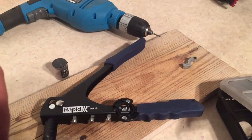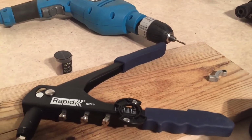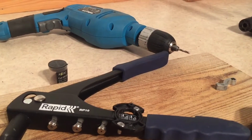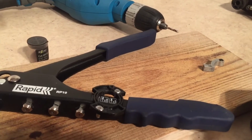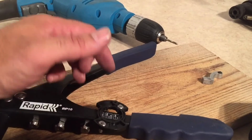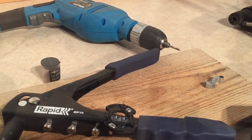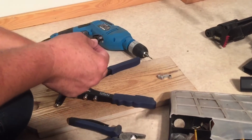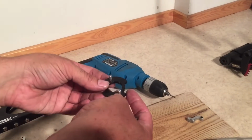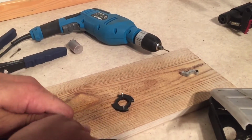Okay, now we're going to leave it for maybe 3-4 hours, something like this. You want it really good and dry before you flip it over and do glue on the other side and leave it for another 3 or 4 hours. But really, this whole process is sort of a 2-day process. You do other things while you do it. All right, so after this has dried completely, after 3-4 hours preferably, if you don't want to just leave it overnight or something, you want to flip it over, and now we're going to glue it from the other side and leave it.